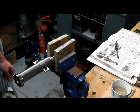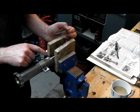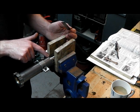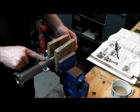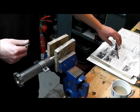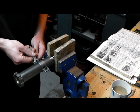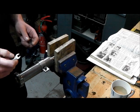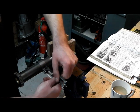I think this is going to be about it for today - a gentle start to the job. This oil thrower here should be an inch, plus or minus a 32nd of an inch, measured from this shoulder. And this one's just over an inch and an eighth, so it's probably not massively critical but it ought to be in the right place. A couple of 2BA spanners and we'll shift it to where it ought to be. I think it's just so that it feeds oil onto the selector shaft mechanism. That one's loose anyway.